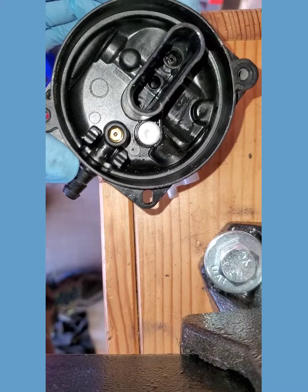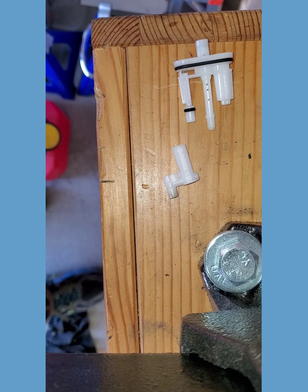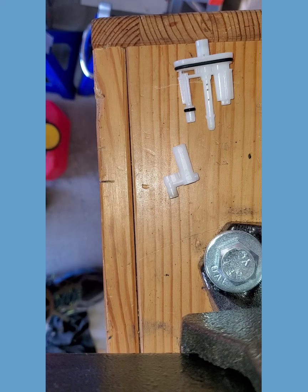Now that all this is cleaned out, I'm going to put those two pieces back together, slide them back into that oval part of this carburetor, put the needle back on the float. And then I'll show you how I kind of redneck-check for proper operation of the float.